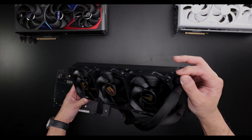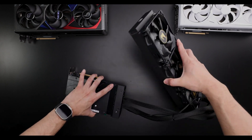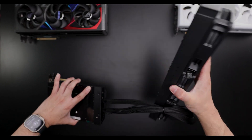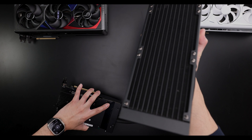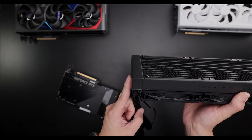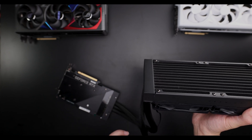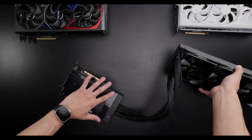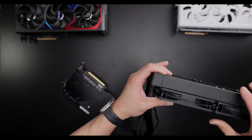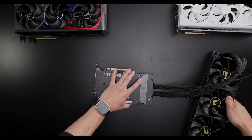This, I guess, is their fill port — but I assume it's a generic Asetek or similar design. It is a slim rad. Since I've tested these already, I'll let you know that this end actually gets pretty warm — about 44°C under load at 500-something watts. So just to let you know, the radiator tip does get pretty hot. The radiator itself doesn't feel like it's heat soaking, but it does get pretty warm.